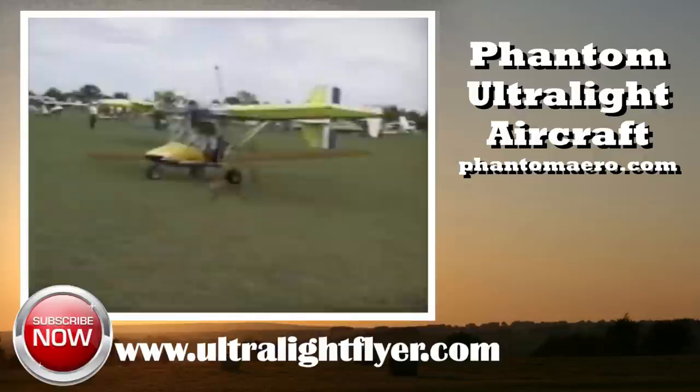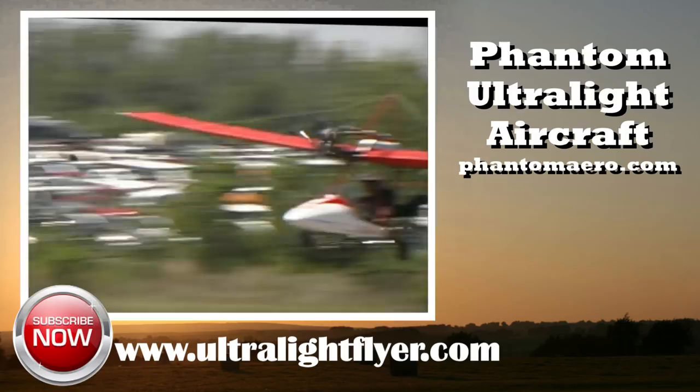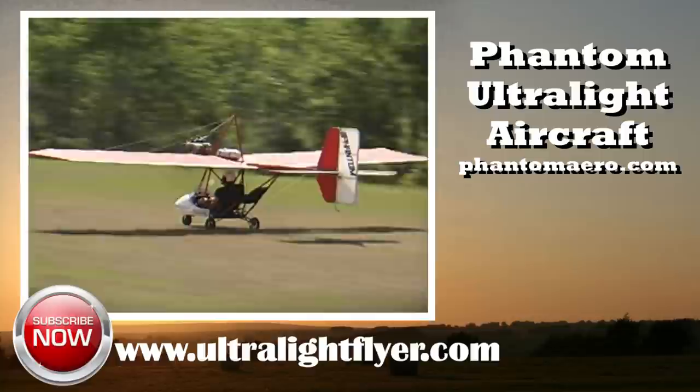If considering purchasing a used Phantom, it is the Ultralight Flyer's recommendation that the plane's fabric, airframe, wings, landing gear, and control systems be thoroughly inspected. If the history of the engine is unknown, it is recommended that the exhaust be removed and the pistons inspected for wear and seizure.